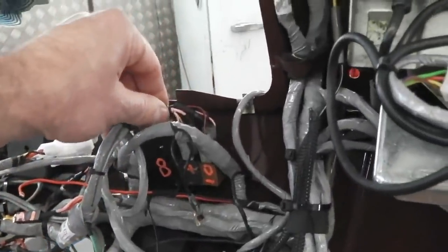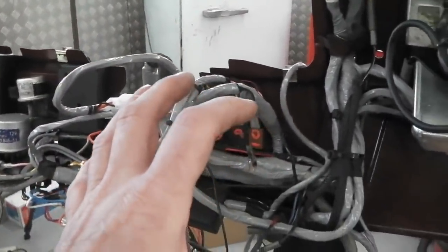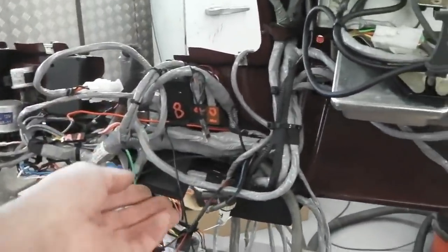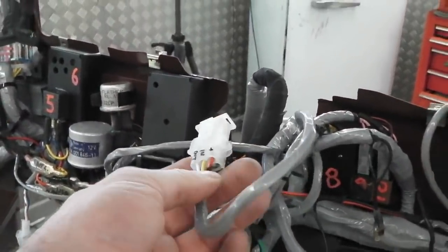So you need to be thinking about how to get these out, which you can, from underneath and from the top. The wiring loom itself, no, you can't get that out because that's fixed in, but you shouldn't have to. There's never going to be a fault in them looms. It could only ever be with the modules, and they all unplug on Molexes anyway to take to the bench. Same on the wiper module, the whole lot comes out to be modified, altered or adjusted.